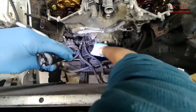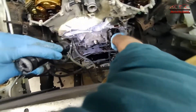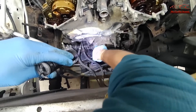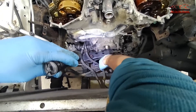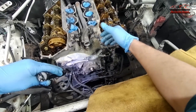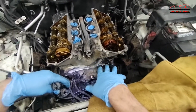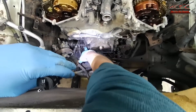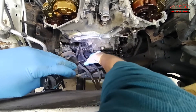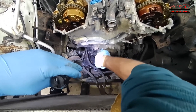But I'm not going to do that. This is the oil pump right here, and it has a pickup tube that runs from here all the way down to the oil pan. It does have an O-ring on it and is not bolted to the timing chain cover. It does have two studs, so in order to install this timing chain cover the oil pan has to be removed — but I'm going to try to do it without removing it, just by removing the studs and sliding it out. The pickup tube has an O-ring so it's not bolted to the oil pump or the front timing chain cover.